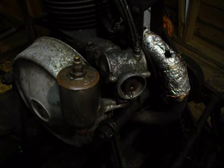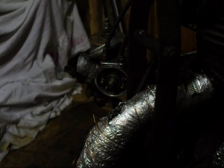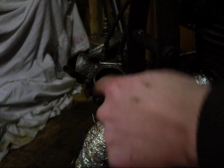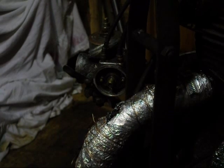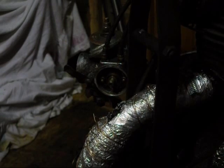I'll just show you what I was saying about the throttle arrangement — I'll take one side off and show you in there. If I just work the throttle you'll see which the throttle control is. As you can see I'm not getting the full movement — it should actually return to about there, which is a bit further around. That there is the throttle, and that there is the mixture control or choke, and that's working exactly as it should.